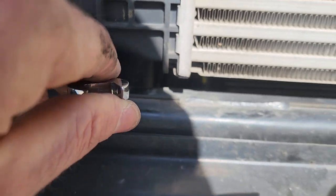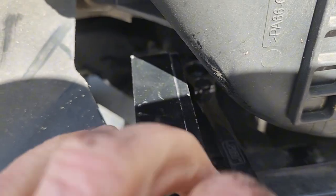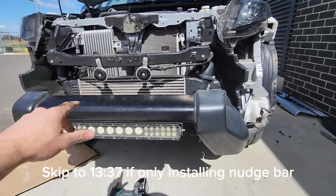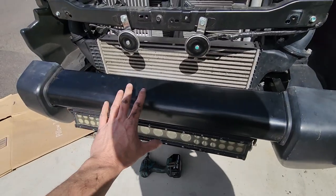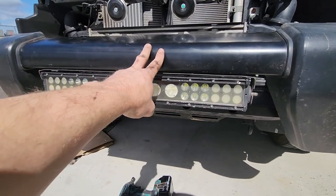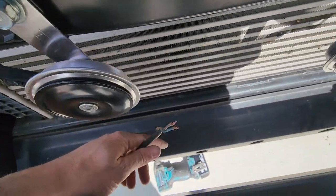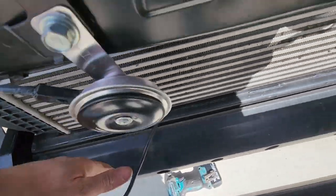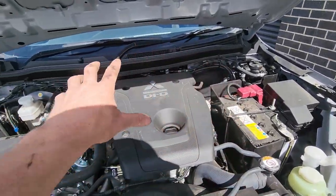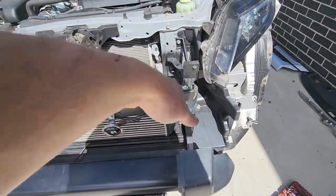A side note — in case you're wondering how I tighten it, I just use a little ratchet. After they're nice and tight, go ahead and assemble the rest of your nudge bar and just pop it on for now, nice and loose. I've just secured the two arms to hold the nudge bar, erected mine, put the light bar on, and set it in place. The light bar bracket bolts into the provided mounting points. I'm doing this now so I can put the Deutsch connector on and run my harness, piggybacking off the back of the lights connector — set it up so once I put the bumper on, I just plug in the Deutsch connector and it's all neatly out of the way.